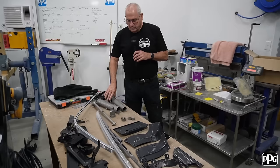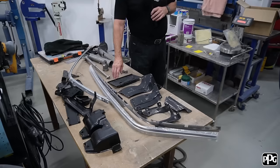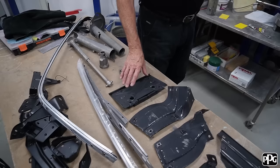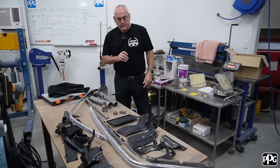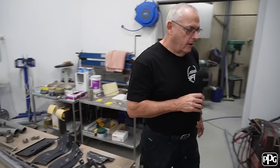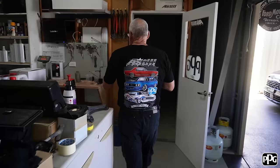One of the biggest issues when painting a whole car is all this small stuff. The steering column has been assembled for reconditioning, and then all these parts here — there's some reproduction parts, some original — we're now sanding them up to have the black process done to them. Some of these I did put some CF black epoxy on, and they're now just getting a final rub before we go with the Delfleet F4949. Then we'll put some Delfleet satin black on it. There's nearly as much work in all the parts as there is in the body, especially doing all the undersides.